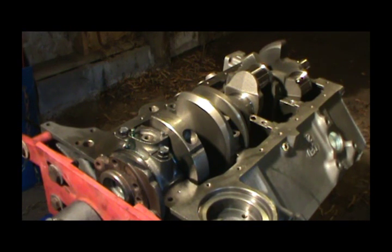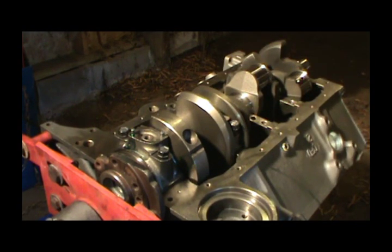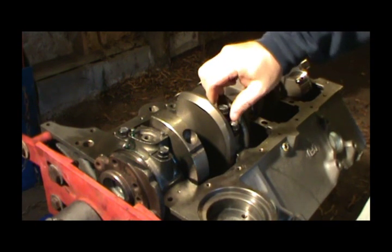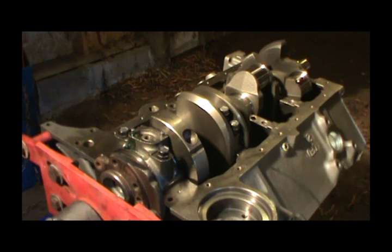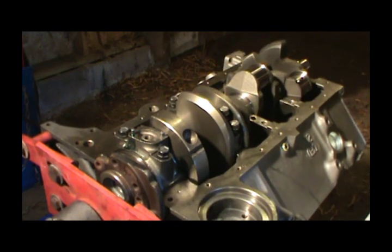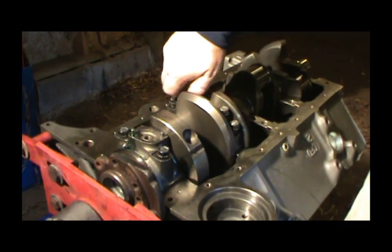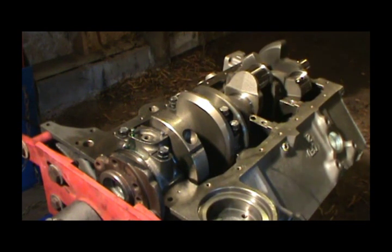These have got four-bolt mains, so you've got smaller bolts on the outside and larger bolts on the inside. The longer bolts are — well, they're the same diameter, just one is longer. That's all there is to it. We'll get the other three bearing caps and I'll come back after I get them put on and we'll torque them down. I'll show you that next.